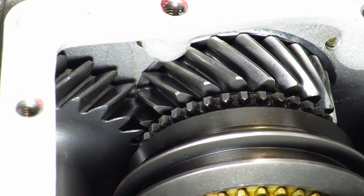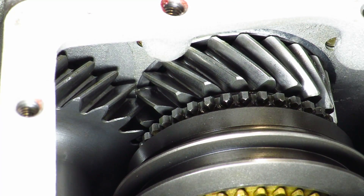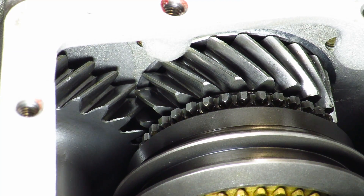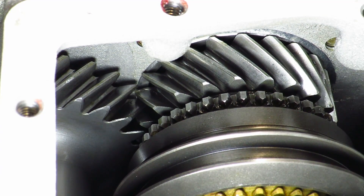The bottom line is that plate was designed to keep a preload constantly on these two gears, preventing this noise from happening. Why does it happen in the first place? It happens because the input shaft is driven through a sprung hub on a clutch. The clutch disc has a spring on it, and the spring can oscillate back and forth depending on engine harmonics. If you've got some severe engine harmonics or vibrations, this input will rattle around — it's an undesirable noise in some applications. I remove them because they create a mess if the plate lets go.